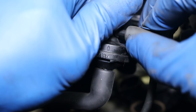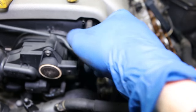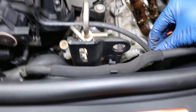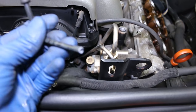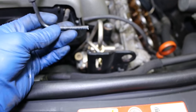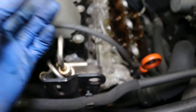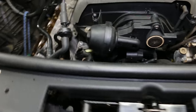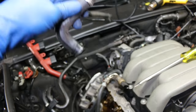Next you want to remove this little vacuum part on the front and come over and remove these. If you've never replaced this line, it'll probably crack on you — just like I was talking about, mine's a little fragile and old so it broke. I have a clean break, so what I'll most likely do is just cut this and extend it over — it'll still work just fine. So anyways, continuing on, now you can get this funky-looking guy out of your way.